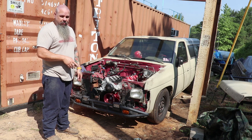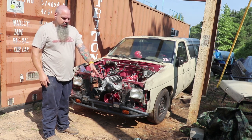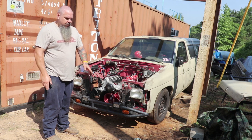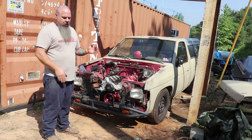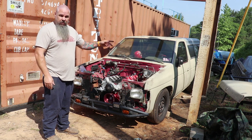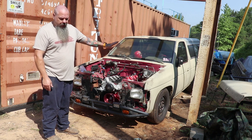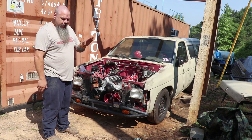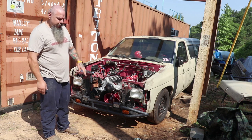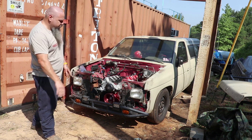I've got this crossmember and then there's another crossmember that's probably a foot or even closer. I'm going to use that crossmember — which is welded into the frame — and come off it with some gussets and plate to mount our transmission. We will also have to do some tweaking on the first crossmember to get it back in for rigidity.